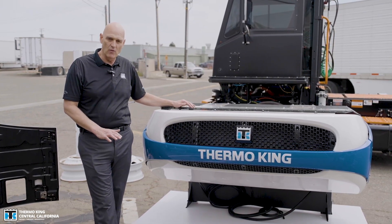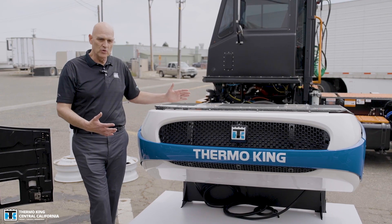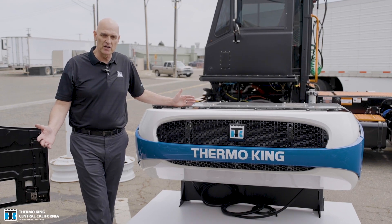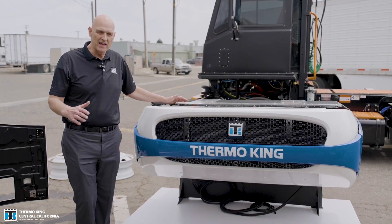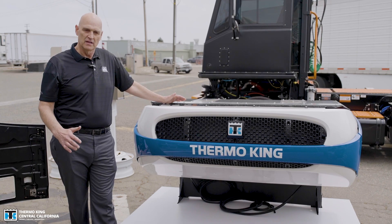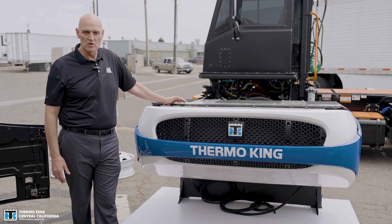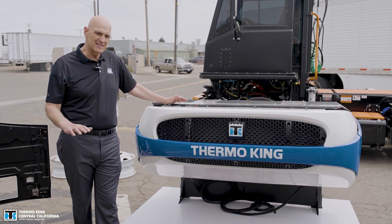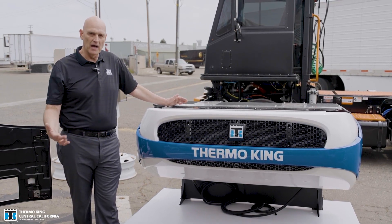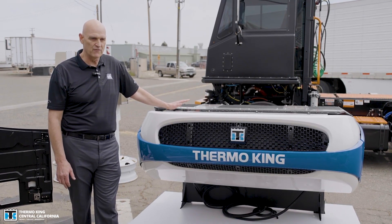Today it will take energy from the truck's batteries, which will take away from some of the drive mileage. If your truck manufacturer says it's designed to go 250 miles, we'll take about 8% of that away operating in frozen conditions with 10 door openings — we've tested at those levels and we're at about 8 to 10% of battery life. You will lose some mileage, but you won't need a diesel fuel tank or any other energy source — it runs fully electric.